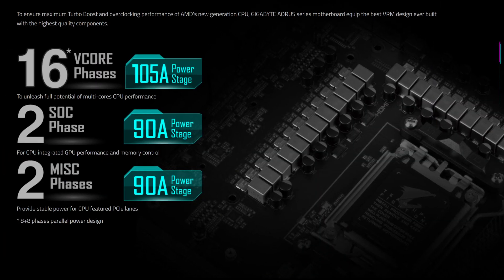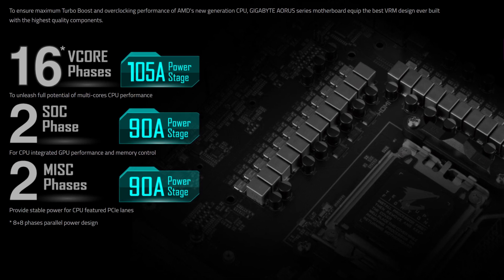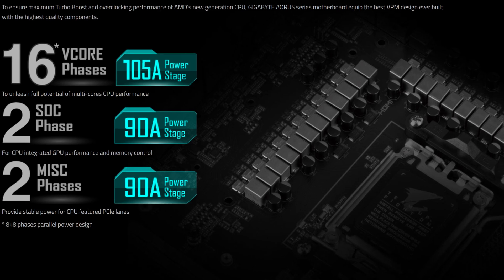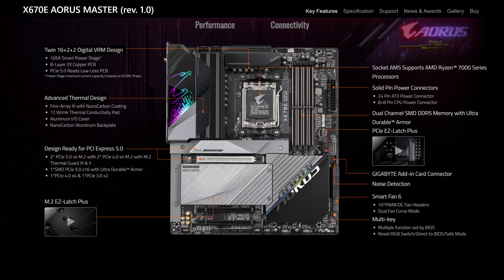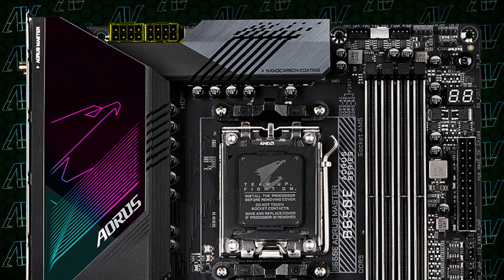Well, it is a bit complicated, but there is a method to this madness. Starting off with CPU power, we already see exactly why this motherboard costs so much, seeing how it has a 16+2+2 power phase configuration rated at a whopping 105 amps. That is absolutely insane, and it decimates pretty much all other B650 and B650E boards, and even X670E motherboards. That power delivery is actually on par with the full-fledged X670E version of this board. Combined with two full 8-pin CPU power connectors, your Ryzen 7000 processor is going to be getting a lot of juice.